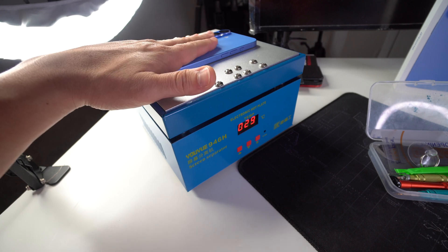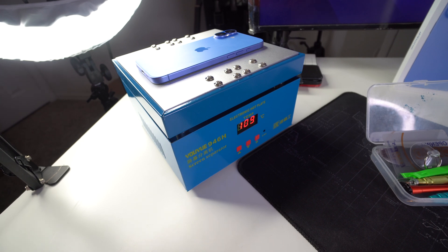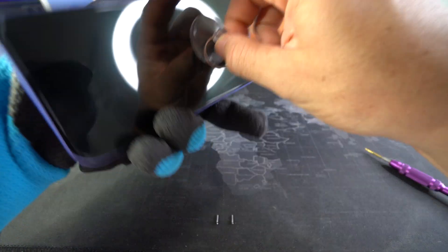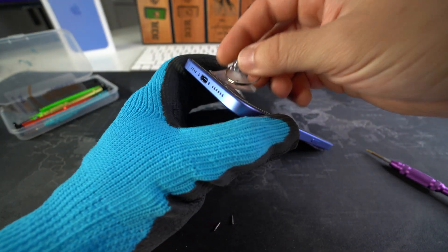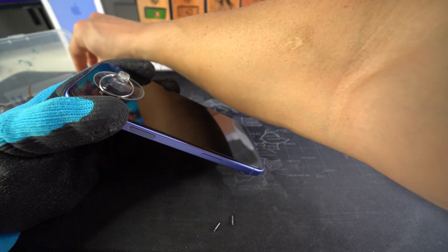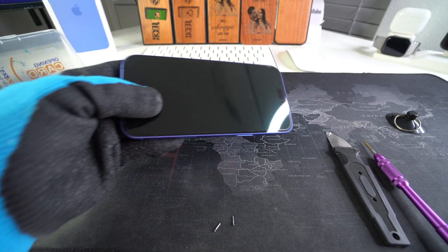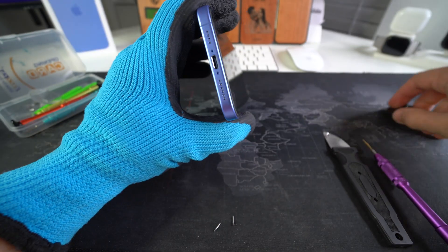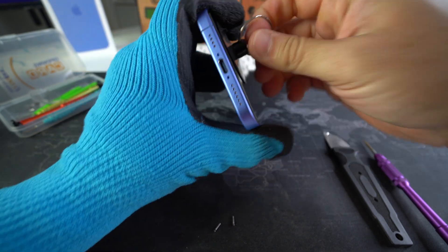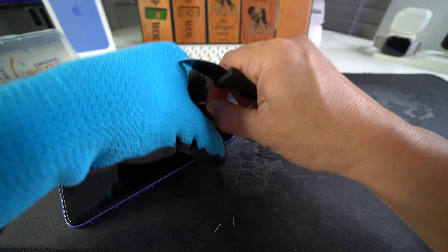I'm going to touch the back and when I feel that it's hot, that's when I'm going to remove it from the hot plate. So it's been about three to four minutes. We're going to be using these gloves since the phone is going to be super hot. We're going to be using the suction cup, placing it towards the bottom of the phone where the two Pentalobe screws were, and we're going to pull up on the screen. See if we can get it to nudge up just a little bit, and then after we do that, we're going to be using these prying tools to get under the screen. If you feel the phone starting to get cold again, just go ahead and heat it up one more time. As you can see, it's starting to lift up — I heat it up a little bit more and now the adhesive is loosening up. Once we see that it lifts up a little bit, we can go ahead and place the prying tool in there.